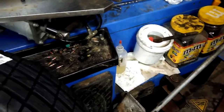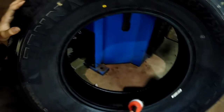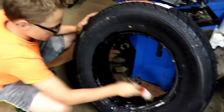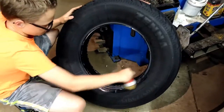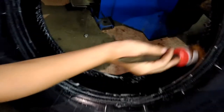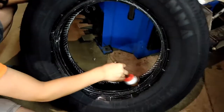We've got the new tire, but before mounting it there's one more thing to do: apply tire mounting lubricant around the bead. Coat the inside and outside of both beads. It's most important to coat that exact spot — right on the inside of the bead — because that's where the tire changing machine rubs. After that's done, put the brush back in the holder.